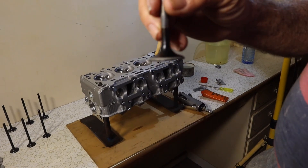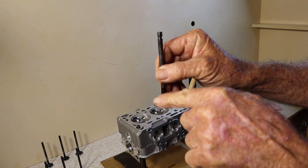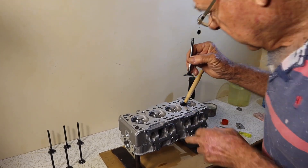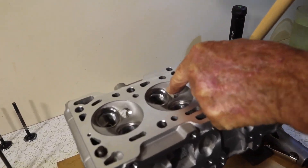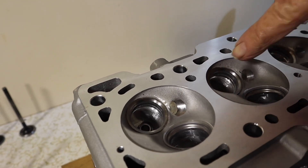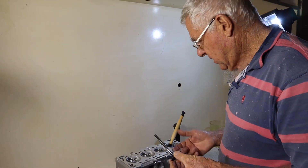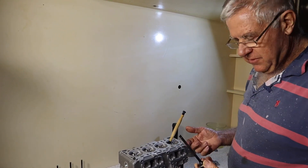The theory is, if you have a multi-angle valve seat — a three-angle valve job — you have one angle where it seats, and another just knocked off the edge, which produces more horsepower. The same applies inside: the first seat is cut back, the second seat is where it seals, and the third seat is angled in so the moment the valve cracks off the seat, it can flow a lot more air and more horsepower. That's a bit more on the theory of how valves work.